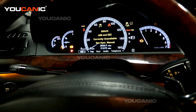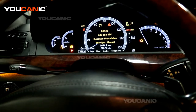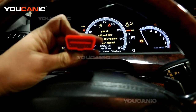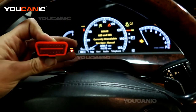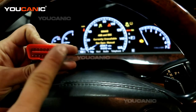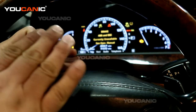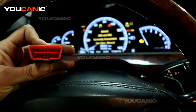What you'll need to do is look underneath the dashboard. All vehicles sold in the United States from 1996 till present will have an OBD2 port. The OBD2 port is going to look like this — it's going to be right underneath the dashboard above the brake pedal. You kind of have to use a flashlight and look down there. Sometimes there's a fuse box down there, so it might be on that panel, or sometimes you might have a little plastic cover — a rectangular shape cover that you need to pop off to expose the port.